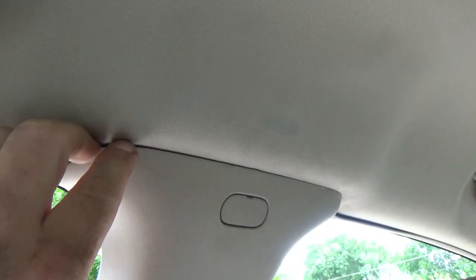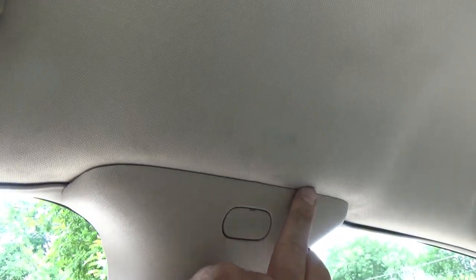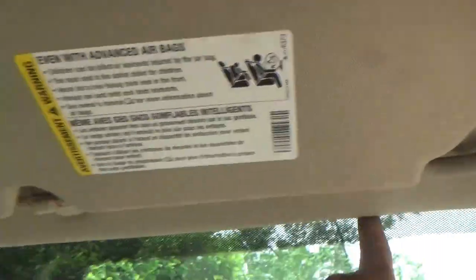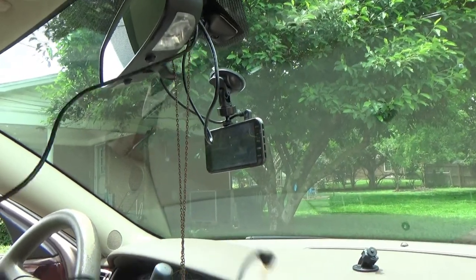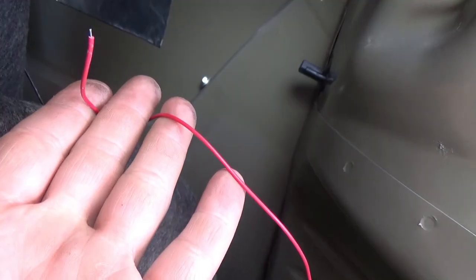This piece is pretty rigid and there's an airbag behind here, so you really don't want to mess with it more than you have to. Just take your interior door trim tool, tuck it in at the top, and it'll provide a gap to tuck the wire through. Back at the A-pillar, finish tucking the wire through and pull the A-pillar back slightly - the trim tucks up the side just like the power wire did. We've got plenty of cable left over. We still need to remove the taillight assembly to get to the wiring for the backup light connection.